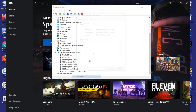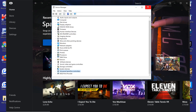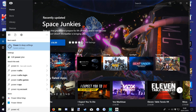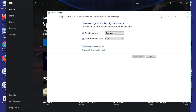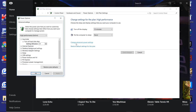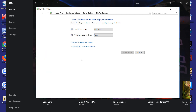Now that you've checked the power management and made sure that's not checked, close out of Device Manager. Next, load up power management — it's noted as 'Edit power plans'. Click 'Change advanced power settings', scroll down and uncollapse the USB settings option. There'll be a 'USB selective suspend setting' — click that one, and if it says enabled, change the drop-down to disabled, click apply, then click OK. Save changes and close that down.